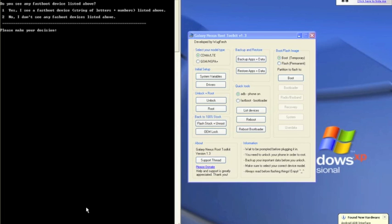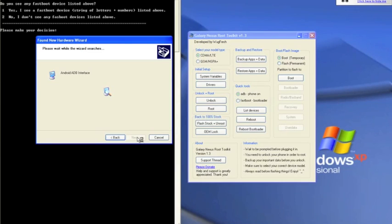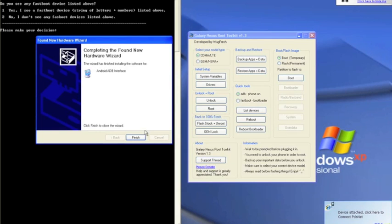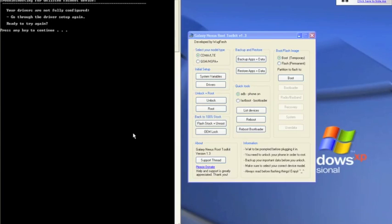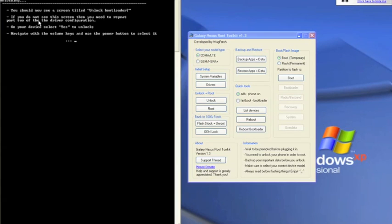I just put this phone on — it's trying to connect after the Parallels switch. You've got to get past this and let it recognize. Let it go ahead and recognize it as a new device. This is a one-time thing, so once you do this and if you ever want to unroot it or send it back, you can do all that right here in the same program. There's the serial number right up there — going to continue, it's going to unlock the bootloader.